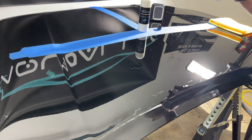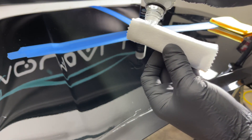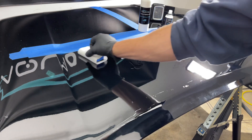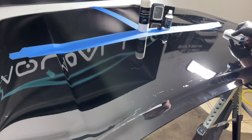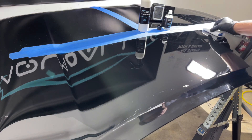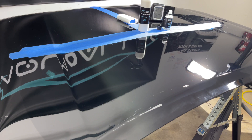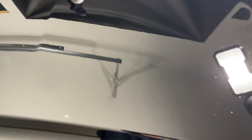How I apply ceramic coating — I apply it stupid heavy to the face. I want to make sure I don't have any low spots. We're going across the board and testing this panel. We're in 54 degrees and 52% humidity. The key for Aqua Bead — we're going to let this go past the normal limits. I'm going to take you along for the ride.